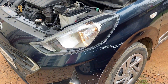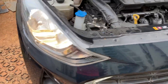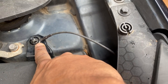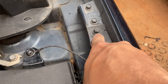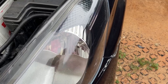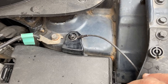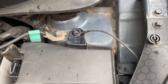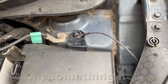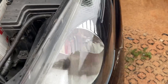This one is working, and this one is also working — but why is this one low? The filament seems a little dim. We gave the earthing at just one point initially, and we noticed that this particular headlamp bulb was a little feeble, meaning the ground was not proper. When we tested a different earthing point, it shone brightly. So if the earthing to a particular bulb is poor, the brightness will be less — please be wary of that. We moved the connection to the better point and now it glows properly.